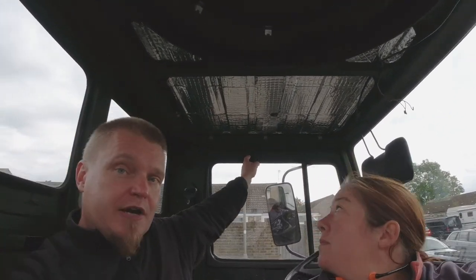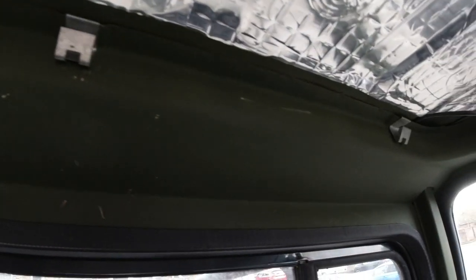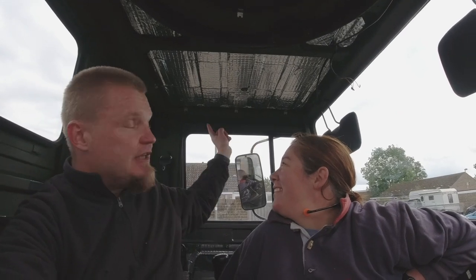But we're going to extend it beyond that lip, and the primary reason for that is that, as you might be able to see over there, there are clips that hold the headliner in place. And I don't want that. I want to use fasteners that I can remove and reattach without a problem. In other words, riv nuts. Woohoo. What a surprise. Not sponsored. Sadly, no. So we're going to put a riv nut in each corner, and that's going to be the main fasteners for that end of the headliner.